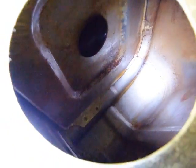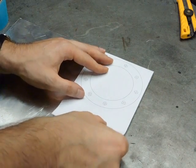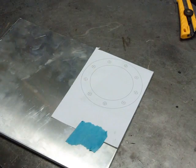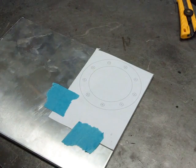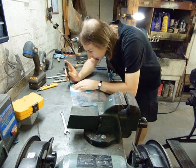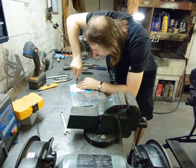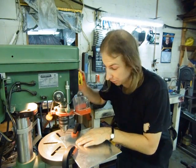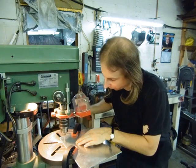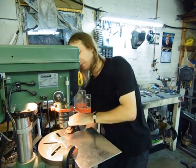This little baffled corner of the tank is just perfect for an in-tank EFI pump. As you've seen me do many times before, I just drew out the flange quickly in CAD, mainly so I could get a location for all the bolt holes that I have to drill. Now just carefully punch them out. I have a ton of holes to drill — eighteen of them, because there are nine holes total with a pilot hole for each, then the final size.